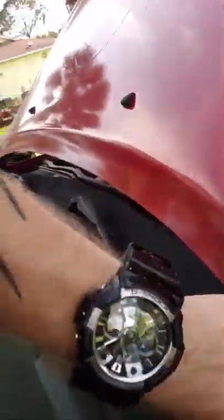Sometimes if you turn your AC on in your truck — if it's like my truck was — you'll start to hear your blower motor just screaming at you. Sometimes you need to replace your blower motor, but sometimes there's just debris that has fallen through your hood and through this little guard here under your windshield. Your blower motor is literally right down there, open.